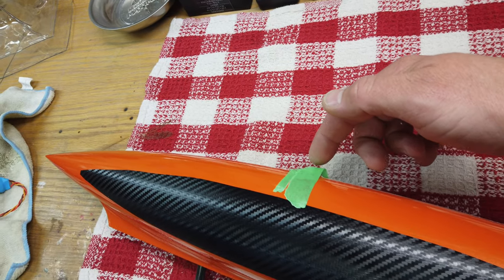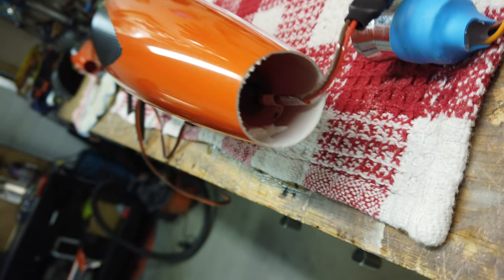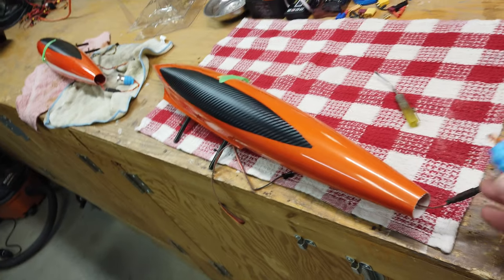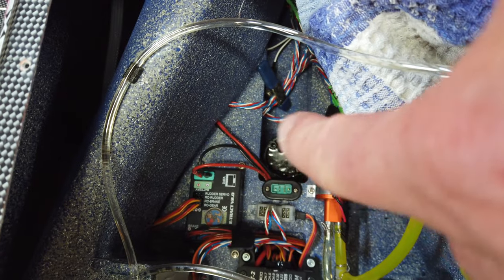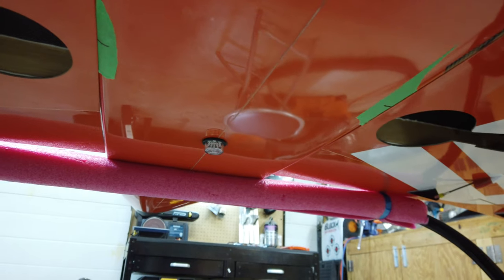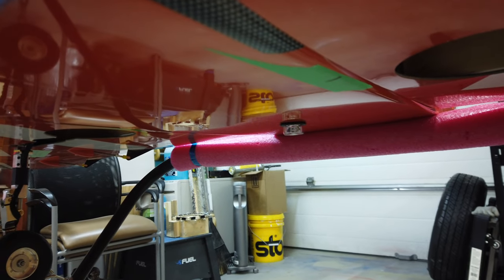Both wingtips are prepped. The red and green marker lights are glued in place with leads coming out of the joiner portion, and I'm waiting for the Shoe Goo to hold the voltage regulator in place. Once that's set, we can glue the tip lights in as well. I installed the red belly light — the red flasher — I got my wife to hold the vacuum on the underside, used my Dremel to make a nice hole, then finished it from the belly side. Finished off with a nice O-ring. That belly light is mental — incredible how bright it is.